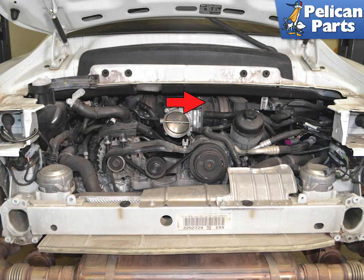To replace the air oil separator, or the AOS, on your 991 Gen 1, you will first need to safely raise and support the vehicle. The AOS is located behind the number 4 and 6 intake runner, indicated by the red arrow. You will need to perform a partial engine drop and remove the engine cooling fans, rear wing, tail lights, rear bumper cover, air box and throttle body, and finally the resonance tube.